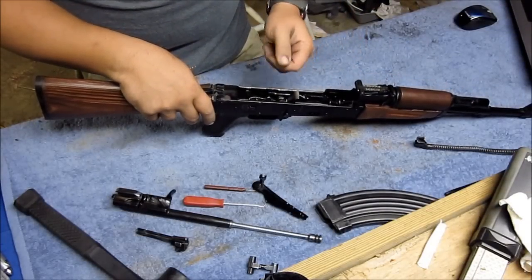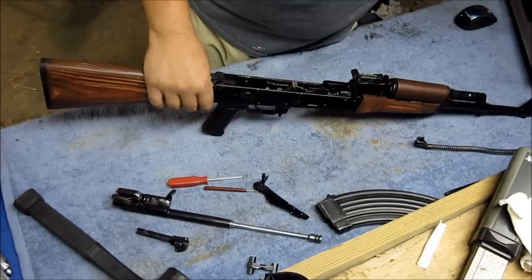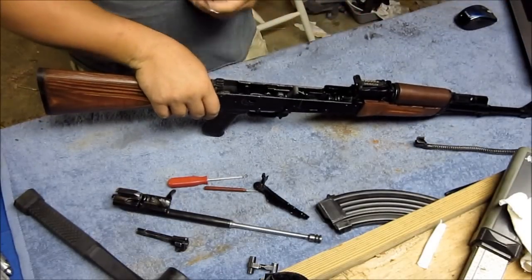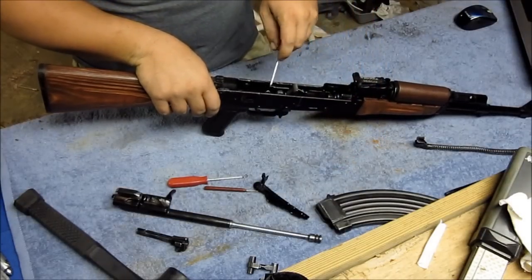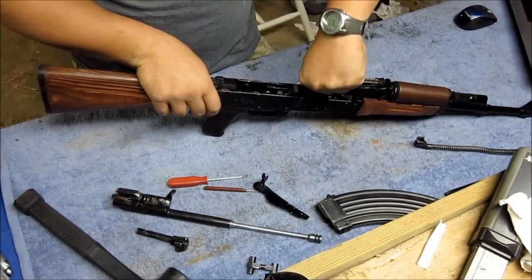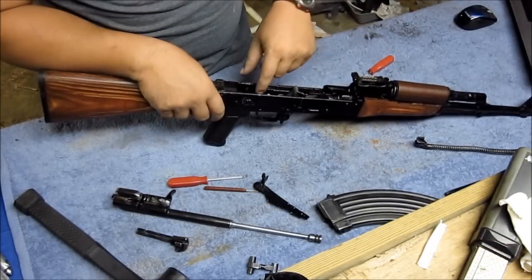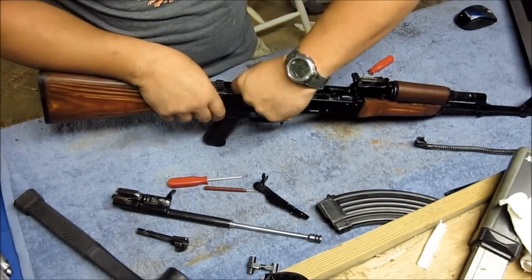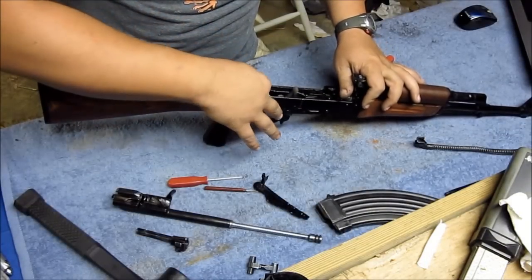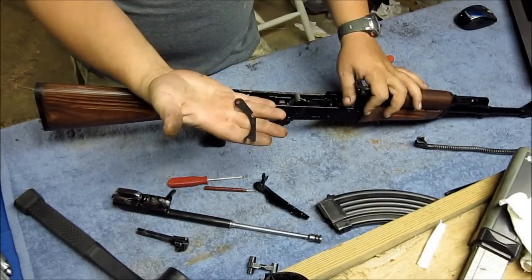If you have a retainer wire, you're going to want to get a hook, get in there, bend the wire out from around your axis pins, get a pair of small needle nose pliers and pull that wire out because your pins won't come out unless you get it out. If you got a plate, just go ahead and take your plate out. I'm telling you guys, if you don't have one of these retainer plates, get one because they're a lifesaver. That's all you got to do is pull that plate out — so much easier.